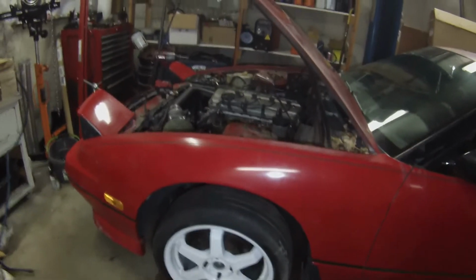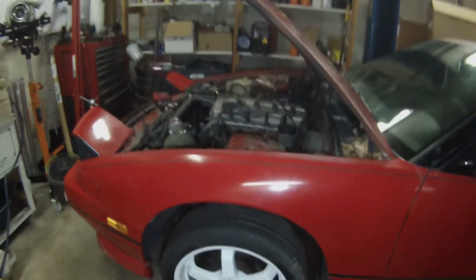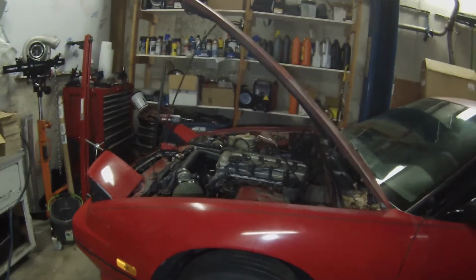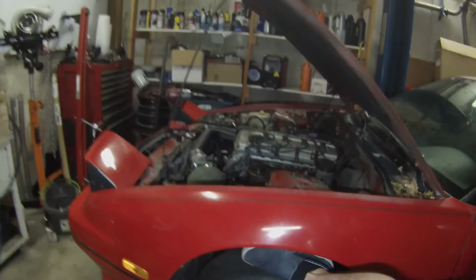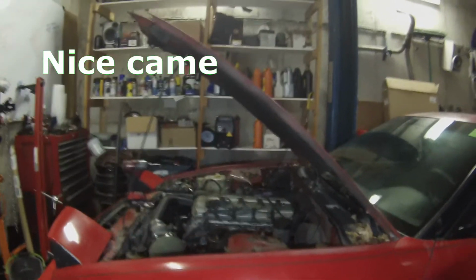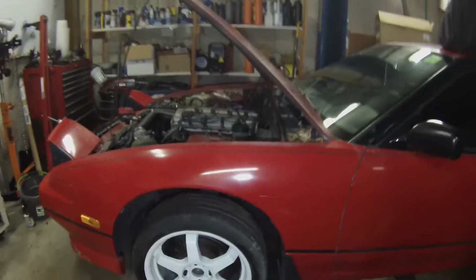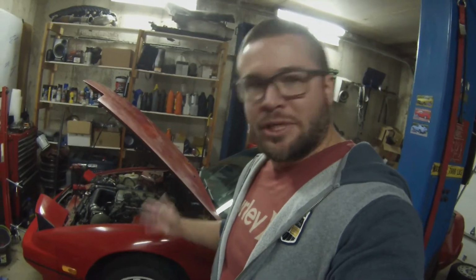I just turned through this wheel on, so we're just going to do a fitment check. The rule of thumb is you shouldn't be able to fit your foot between the fender and the tire. Oh yeah, it's a little snug, but I think it'll work. So we'll eventually probably just put this on drop spindles and maybe some coilovers. I want to try and help with the roll center for this car, but it works for now.